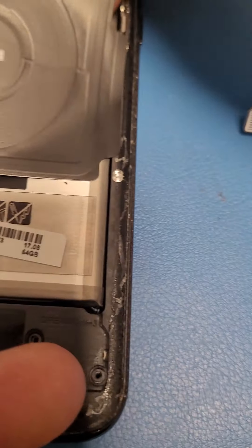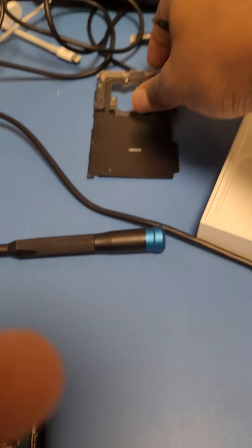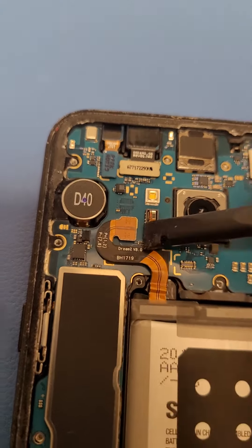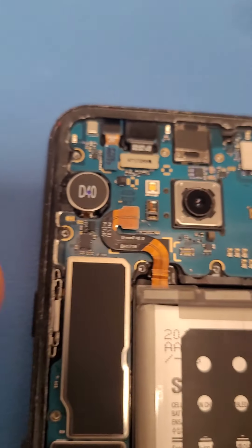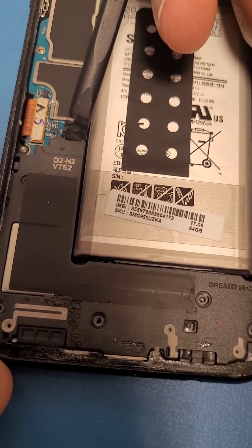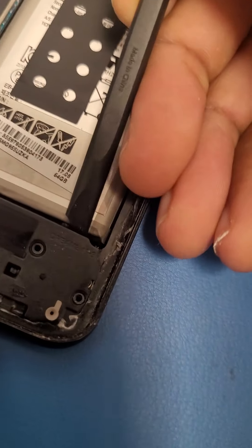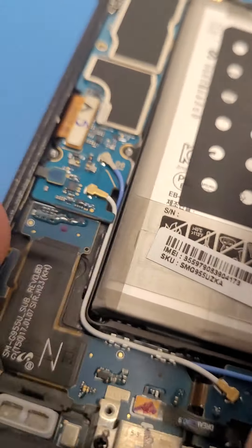Be careful because this is a wireless charger — you want to make sure you're able to use it again, so take that out safely. Then the first thing you do is take the battery connector and disconnect it. Go underneath and twist, then take the cover out — go underneath like this, bend it, and there we go, it pops out.